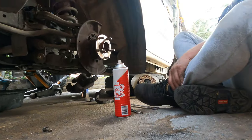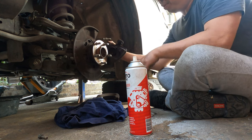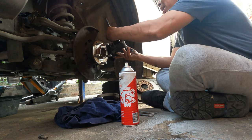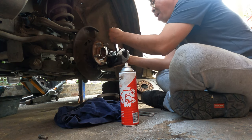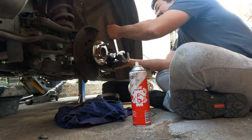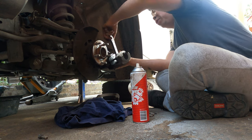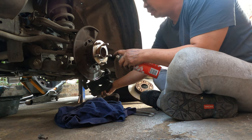Now we replace the brake pads. Before you squeeze it out, see the O-rings on the caliper here — I always spray something on to lubricate before I press it out. My brake master always does that, just in case something gets stuck. Those rubber boots protect the dust from going inside the cylinder where the brake piston is. Squeeze it out slowly — all the dust will break out and fall down and it won't damage your seal. Clean up all the dust as well — that's it.